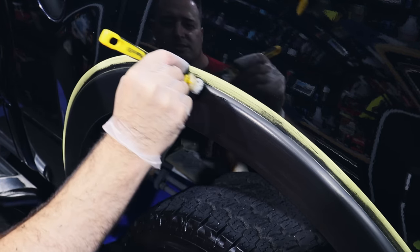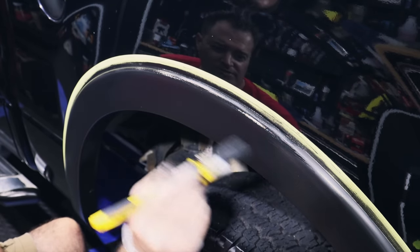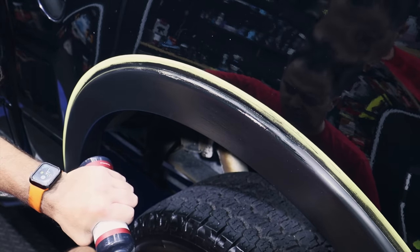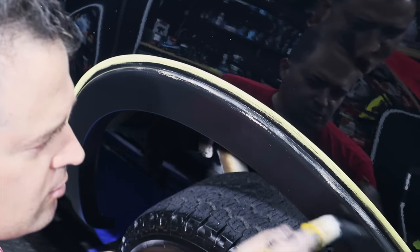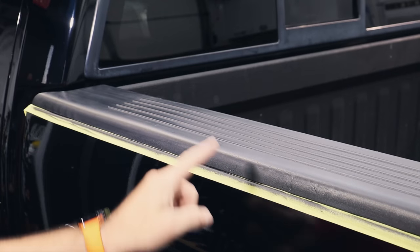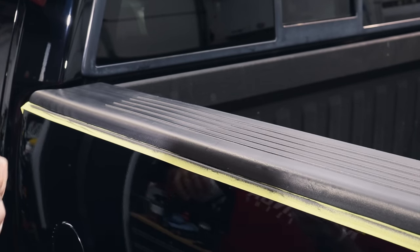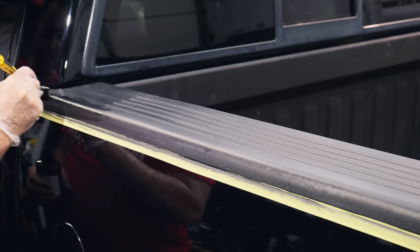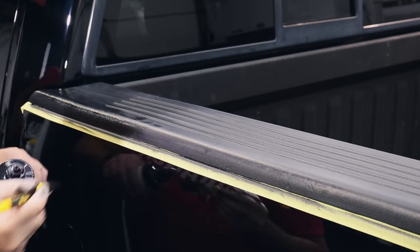The damaged trim can cause things to be weird — it will absorb at different rates and dry faster in some areas because it's absorbing into the plastic. Your location, heat, and humidity will make a difference. I'm trying to end with even brush strokes — no cross-hatching, circles, or patchiness. You want even brush strokes. Much better already. This second coat should be the final coat — it's looking really good at this point. Just factor the time this takes into what you charge.